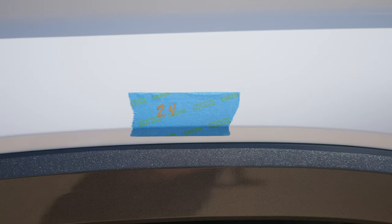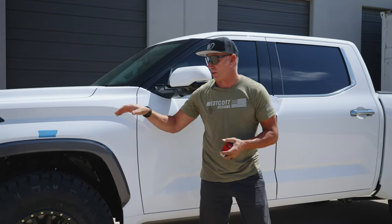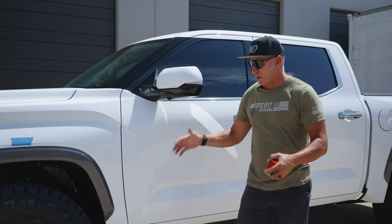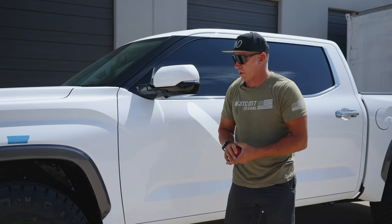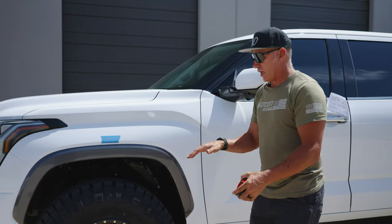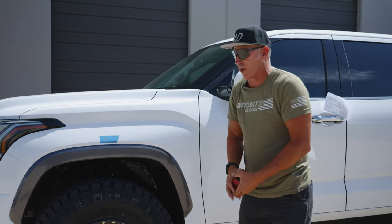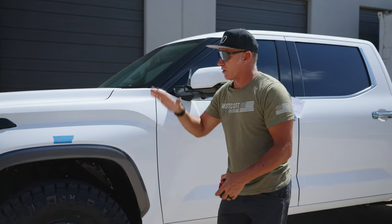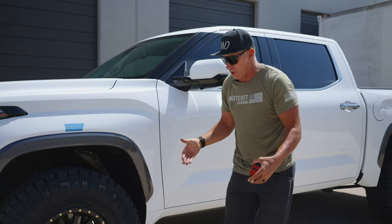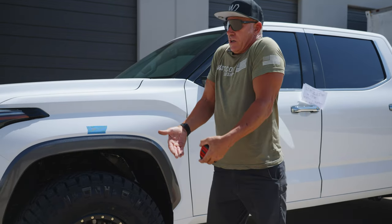We designed this kit to be a quarter inch higher in the back. So if someone tells me their truck is three-quarters of an inch higher in the front than in the rear, most likely it's not riding correctly because the truck is trying to pull the wheels back underneath it as it drives forward. When you go over a bump, it tries to pull the wheels even further underneath the truck, so it doesn't allow the suspension to relax — it's very stiff. The suspension is pre-loading even more as the tires pull underneath the truck as it propels itself forward.